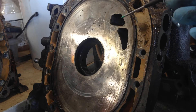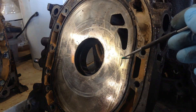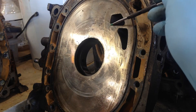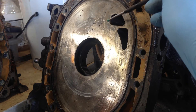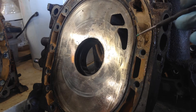The iron needs to be assessed for various other wear paths. One is the wear depth on the elliptical eye-shape ports. Also this area here where the oil control ring runs — this can sometimes wear quite low and be beyond tolerance even though it looks nice and smooth.